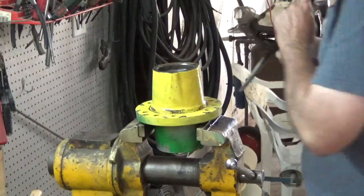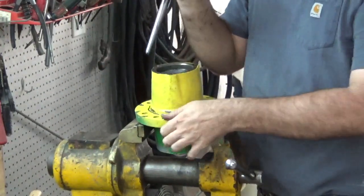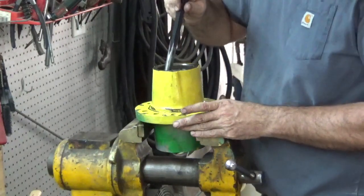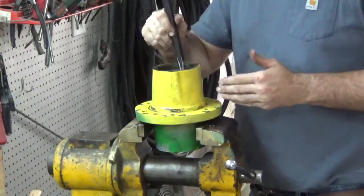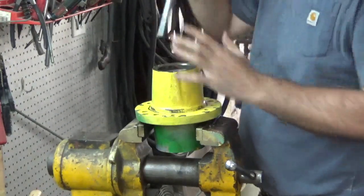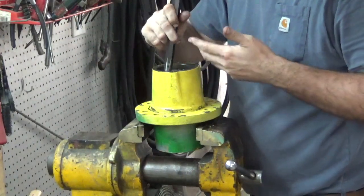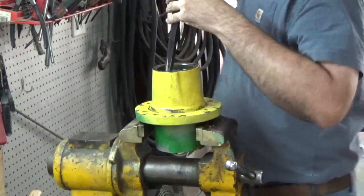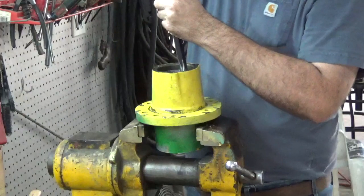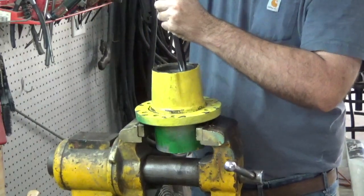Okay, here we are. I've got the wings set up — the little indentions — this way and this way. Because if you hammer over here it's not going to sit real well on a vise, and you don't want to put a ton of pressure on this cast iron. But when you do this, you want some backing here and some backing over here. We have this support, we hammer, we have strength. It happens a whole lot easier — you don't have bounce, and the force from the hammer moves directly to move out the race and the dust cover holder. Here's the pain-in-the-butt part. And you work from side to side — hit the race, not the bearing.